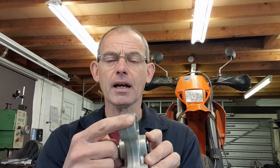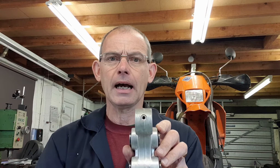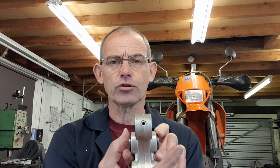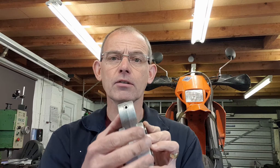I've left that overnight and it's now absolutely solid - I can't move the bearing; the sealant is really doing its job. I've taken the grease nipple out, which actually helps because you can look down the little hole and make sure the groove in the bearing is lined up with the grease nipple hole. Mine is lined up perfectly. So that's now solid - really pleased with that.